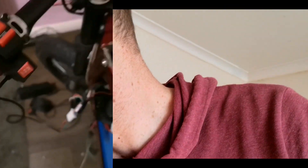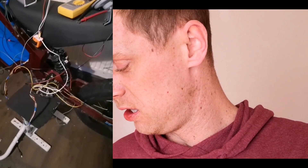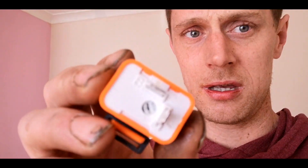A few things I've learned: I knew a little bit about 12 volts, but I didn't realize — I went to the car shop, got a 12-volt relay for the indicators, a little two-prong one to keep it simple, easy to wire up, and it didn't work. Apparently they've got to use a certain amount of amps for them to actually work. To get the LEDs to flash, you need this specific relay here which works for 12-volt LEDs. Also worth noting: on the bottom of it you've got an L and a B — your live actually goes on the B, so it's worth remembering because it doesn't work otherwise.